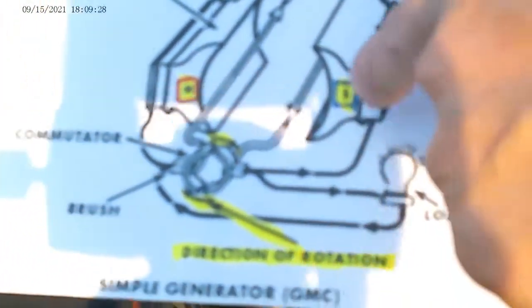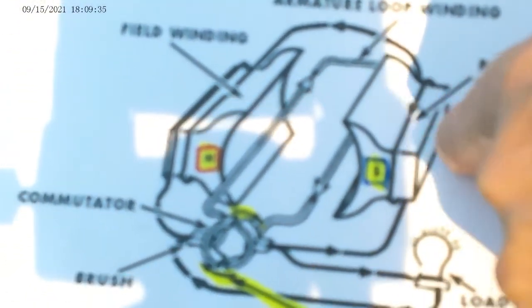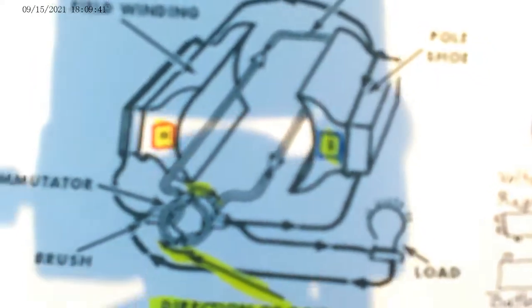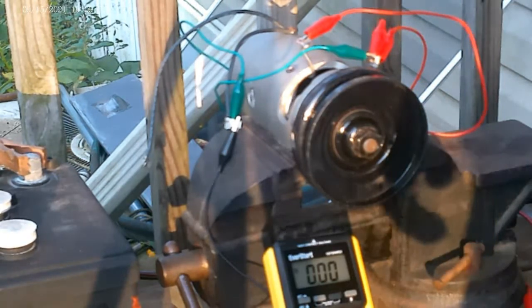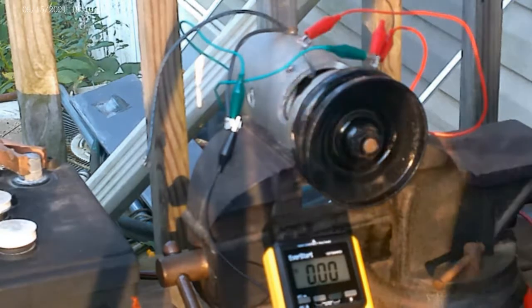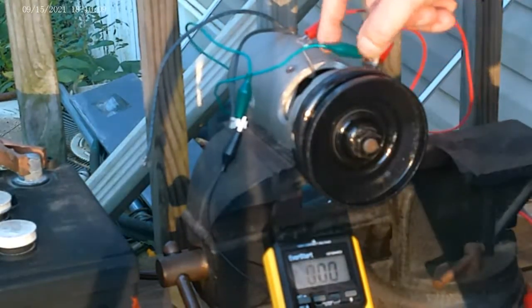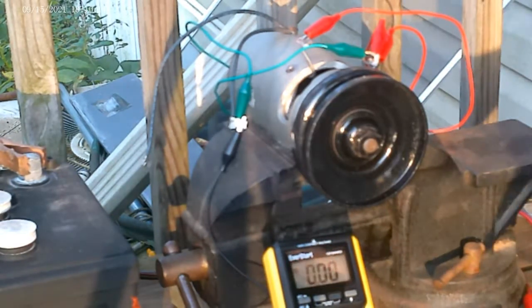These field coils here — on this six volt generator, because the coils are reversed, this is now a north and this is a south, and it runs the right direction. I don't know if that's because the armature was wound the wrong direction, or if somehow when I took it apart the fields got reversed. I have no idea. I'm also not sure if this wire will reach over to where it needs to go — we'll have to see.